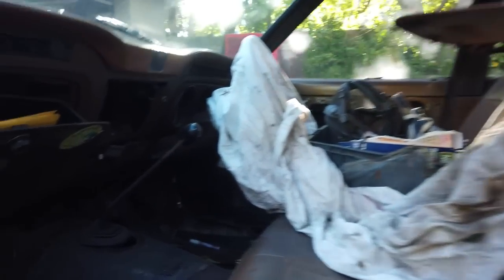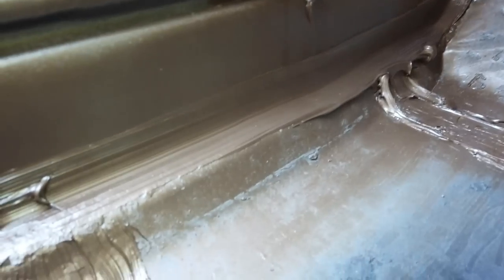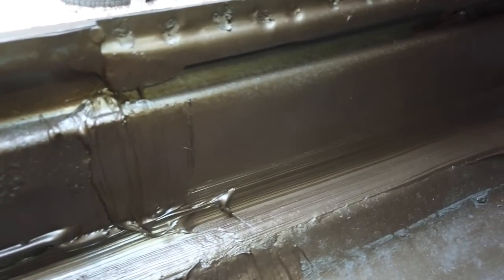Also finished the floor here. So we're colour coded in. We've got Tawny Brown in a rattle can. So we've seam sealed the repair. We did the inner floor. So that's seam sealed in. It's all nipped in at the top, and the seal comes down continuous. I peel back the rest of the seal so it's a continuous line. Even I can't tell that's been done.